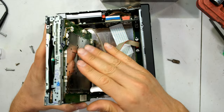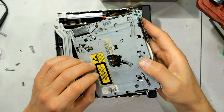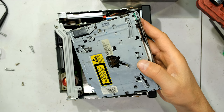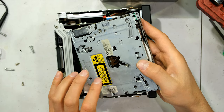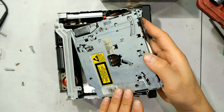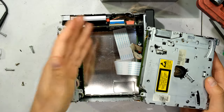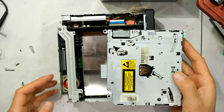I had worked with this and cleaned it, but this is not necessarily causing the MOST bus failure. Problems here would cause the navigation to disappear, but won't necessarily reset your whole MOST bus causing everything to power down and reboot — for example if you're listening to music and everything goes off. Having oil here and things like that would cause your navigation not to function properly, but the MOST bus would still work. You can pull this to the side to inspect if there's any oil — in my case there was none.